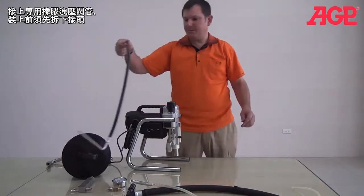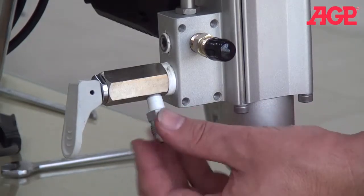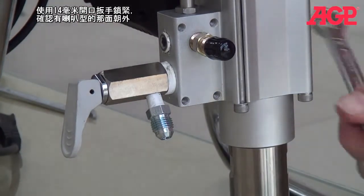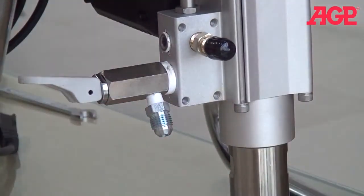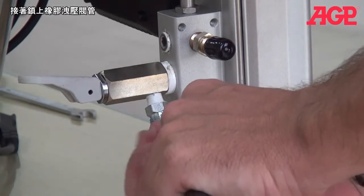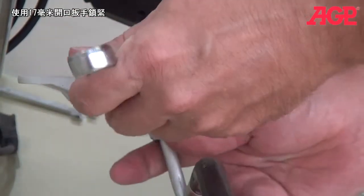You can put on a special hopper-type drain hose, and there's a nipple right on here. You can just remove this nipple. For this one you need a 14mm wrench. Snug it up. And now we thread on the drain tube itself — that's a 17mm — and you can finally tighten it.